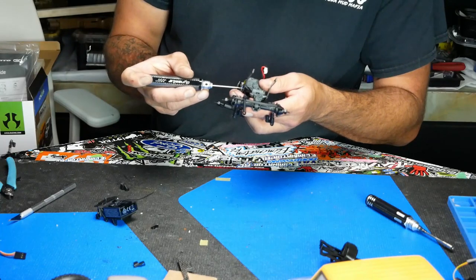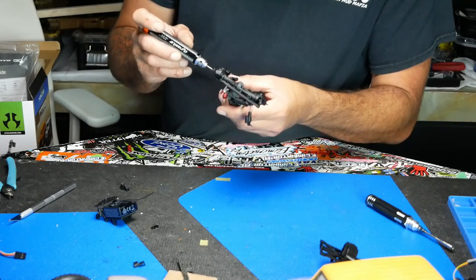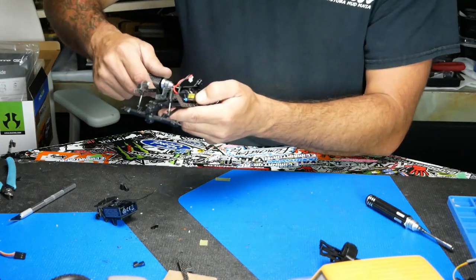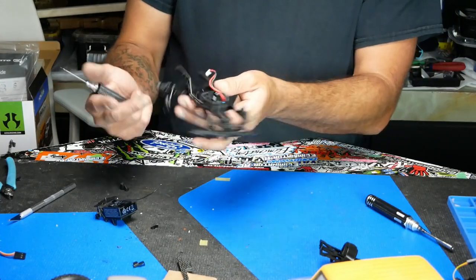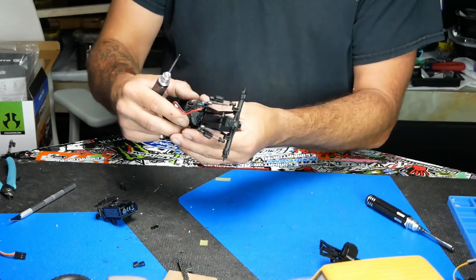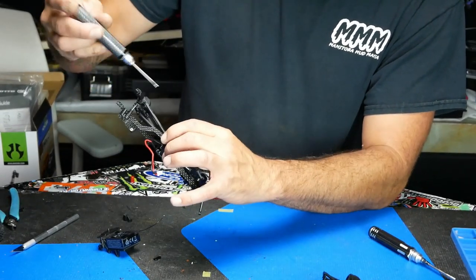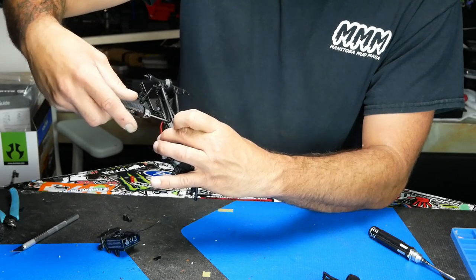You can either take a bit of shoe goo and put that in and mount it up right now, but we want to get this guy rolling back together. So another thing you're going to want to check — make sure everything is not too tight; this will not work, everything is binding. You need to go through and just back up on your links. Make sure everything's not too overly tight. Even the links they put in from factory — right now when you have the suspension off the truck, it's best to go through and get it all nice and floppy. Just loosen up all of them.